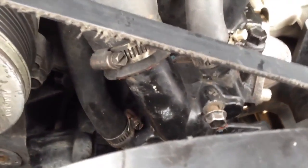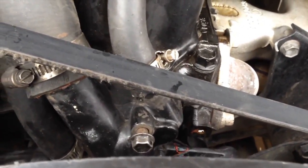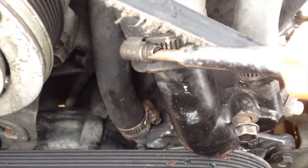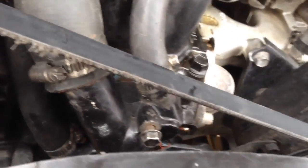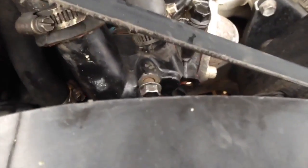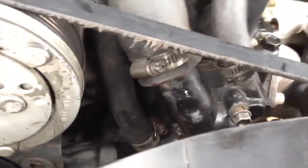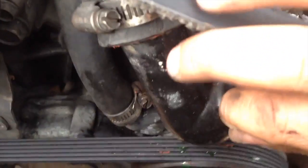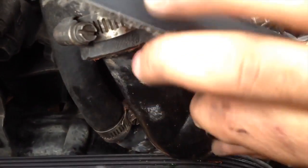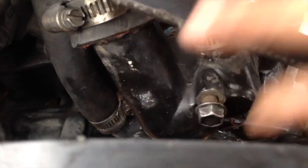It's a simple job — no big thing. With a screwdriver we're gonna undo the brackets here. That one's undone, and then this one too. Then with a 13 millimeter we're gonna loosen the bolts. As you notice, I already have this one undone, and this one too.